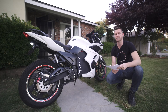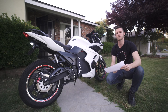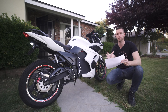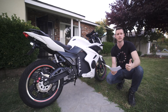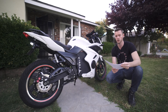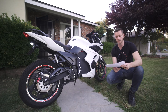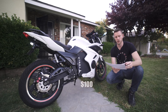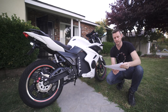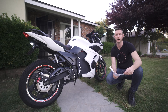Moving on, we built two different battery packs and were able to salvage the original defective lithium ion battery pack that came with the bike, giving us three battery packs total all wired in parallel to build one big massive battery. The first battery pack was $645.02, factoring in things like a spot welder. The second battery pack was $581.52. Battery materials were $35.52, the BMS battery management system was $29.43, and nickel strips for building the battery packs were $100 — probably a total of about $1,400 to build two 72 volt 40 amp hour lithium ion battery packs.